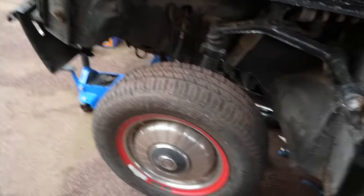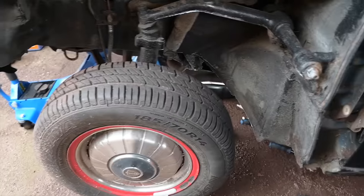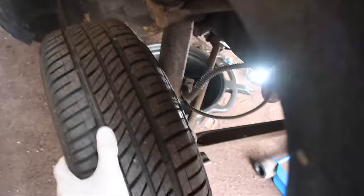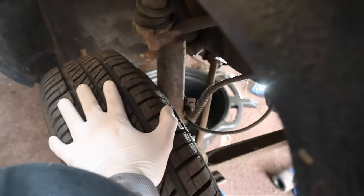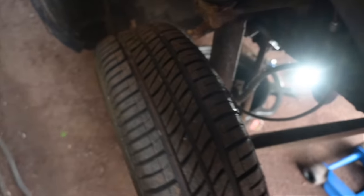Whilst I was lying under the car trying to turn that screw, which is incredibly tight, I did actually just inadvertently turn this wheel. And thought, oh gosh, you know what? That reminds me, I need to go and check all the brakes on this car. Wandered around the other side, seeing as the car is currently jacked up, and guess what? This wheel is so solid, I cannot turn the thing. Jeez. So I think I found the reason that the car doesn't move. It's not the gearbox, it's that wheel. Well, those brakes, in fact.